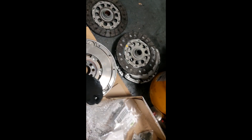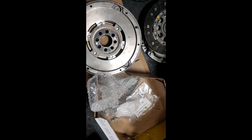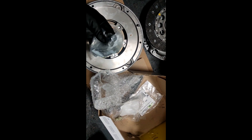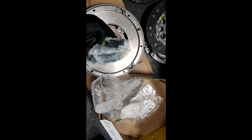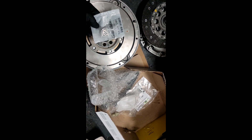You've got to make sure you get the right flywheel. I'll show you the other flywheel in a second but this is the flywheel you want — it has to be recessed like this and you have to have these bolts. There's the part number, and this is the pilot bearing.